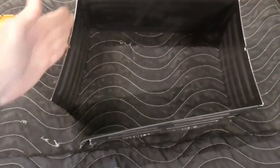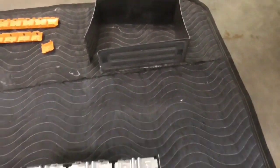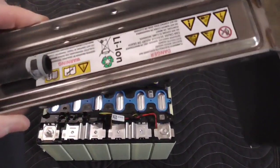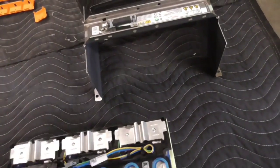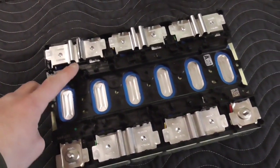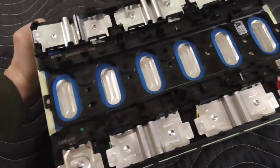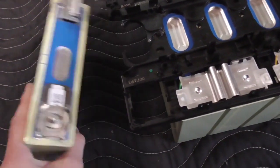After that, this piece comes right off and you can basically just slide it right out. You can see it has this kind of concave shape to it — I think that's part of the spring tensioning. So after that, this is what we have right here. This thing actually just slides right out at that point. We have the venting for the cells that comes out the top there, and that's just welded on here — pretty thick steel plate. That leaves us with the module, and since I cut that cell off, it's almost wanting to come free. All you have to do is bend up those metal edges and it just pulls right out.